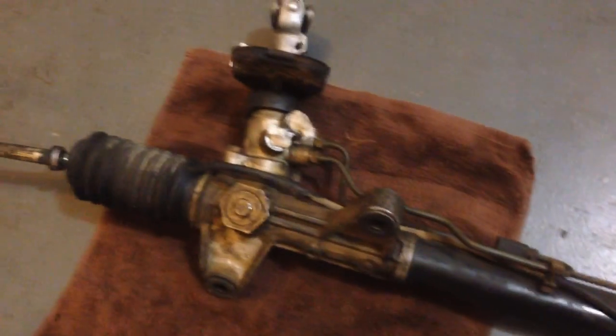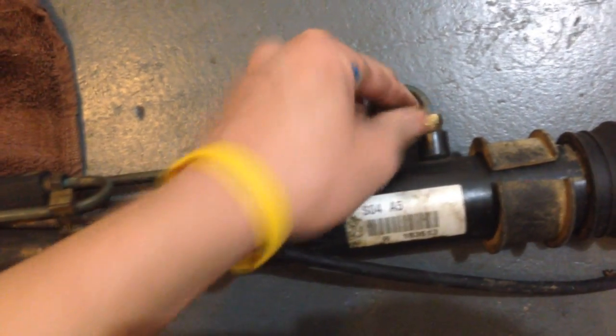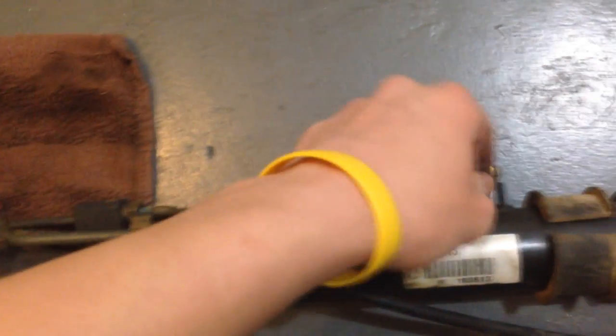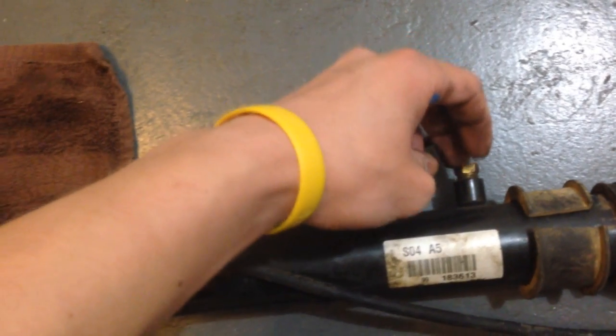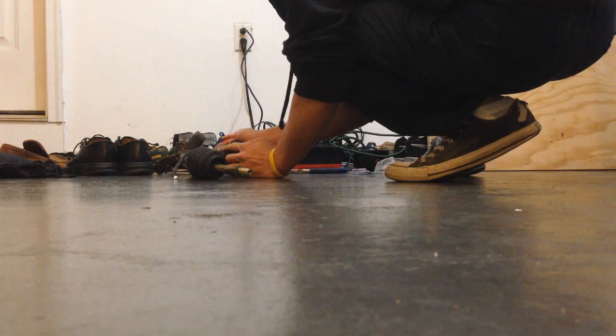This is my power steering Civic rack, and because these bolts, for me, are kind of stubborn, I can't take them off with an open wrench. So I'm gonna cut the lines here with a Dremel tool, and cut the other line right here, and then remove the line and get my impact and impact the bolts out. And then just like the injector valve body, I'm gonna JB Weld the openings of the bolt and reuse them later to seal it up.